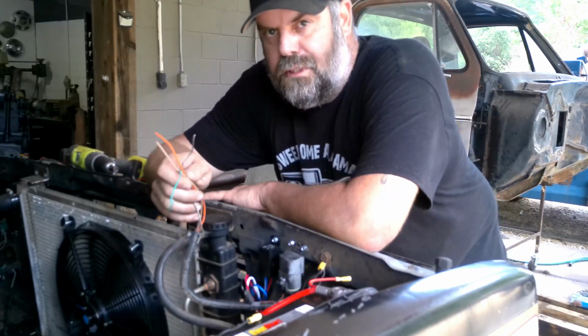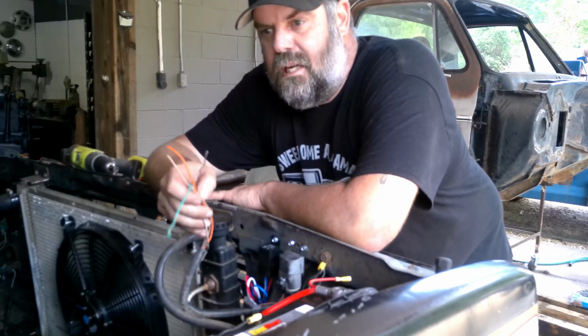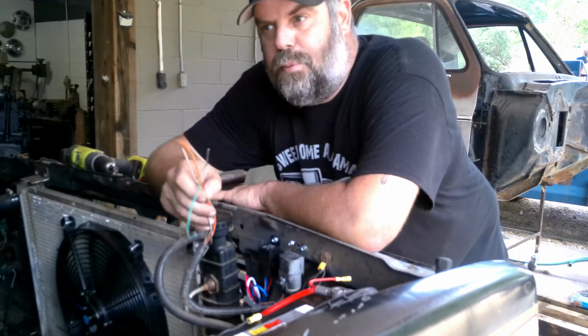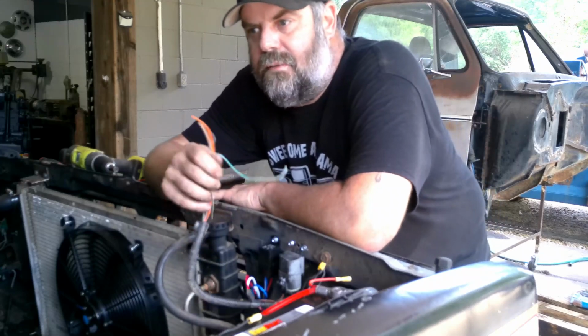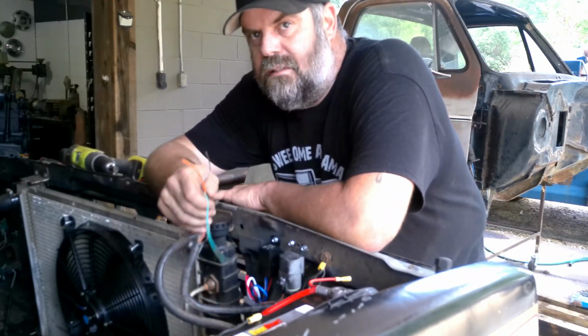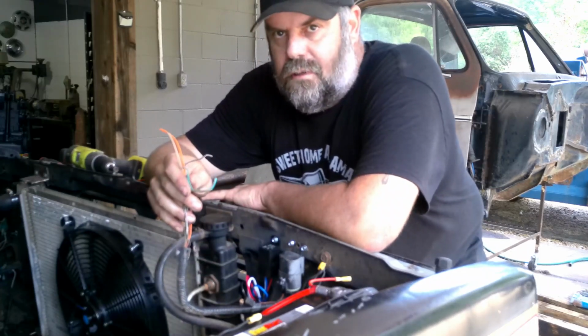And if the oil pressure switch does not have oil pressure and doesn't complete a ground, then your fuel pump does not work. Like when you turn the key on, it primes the fuel pump, and then the fuel pump shuts off, and then when you're cranking, it doesn't turn the fuel pump back on until it shows oil pressure. Well, we ain't doing all that crap.